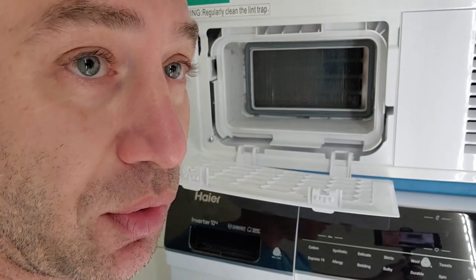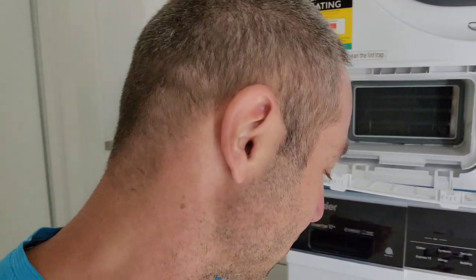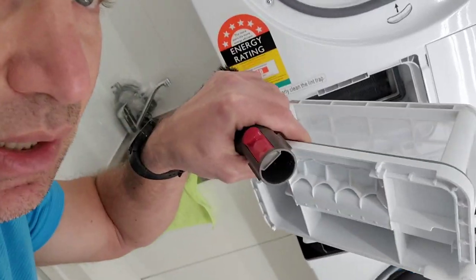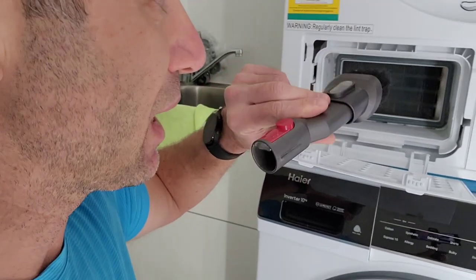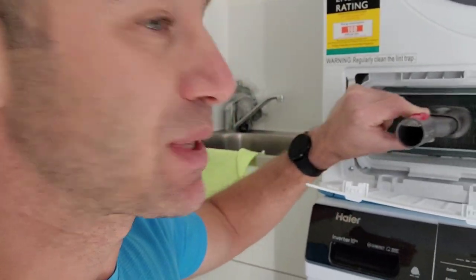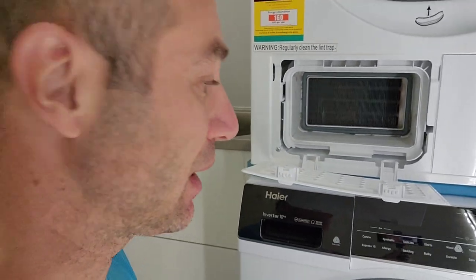As you can see, I've got a little bit of dust on the heat sink. Mind you, I'm doing my drying on a weekly basis — I almost don't hang my clothes outside. After a year of use, it's actually in quite good condition. I'd suggest, if you would like to prolong the life of your heat pump of any brand, that's the place to clean for sure. Skimping on cleaning filters is really a bad idea in general. So my first tip: one filter here, clean inside; one filter here that's stuck in, clean inside the filter. And when you finish, also take your time — if you don't have a Dyson vacuum cleaner — with a gentle brush, brush it down and then sweep. Do not move from side to side, because if you damage those fins, you're reducing the thermal exchange ability of the heat pump and it will stop working as advertised.